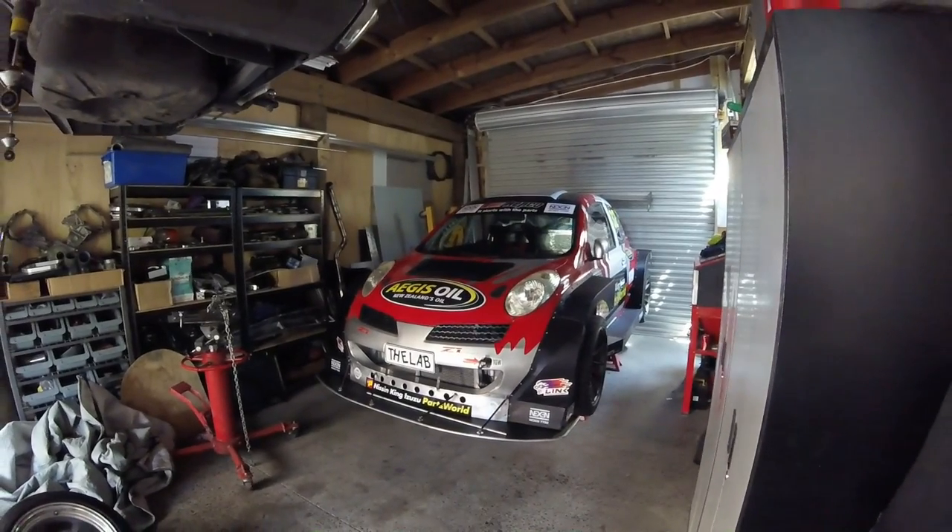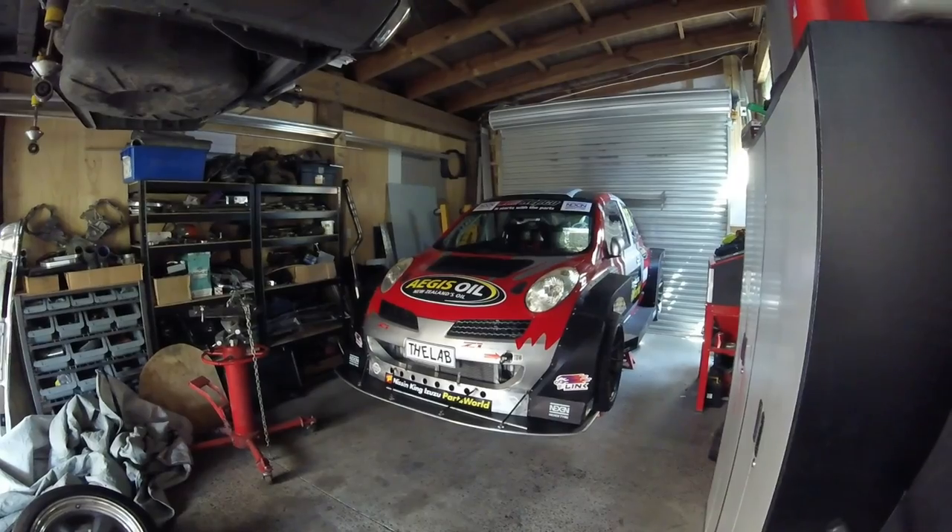She's ready to go. I'm thinking we need to do another drag race session. At the last session she was cutting out after gear changes - a surge in power, then cut, then come back again. What was happening is the boost pressure setting was too close to the manifold air pressure boost cut limit. There's a little bit of hysteresis, so if you're approaching it quickly the system will see it and shut off before you actually get there. We were only about 10 kPa away from the MAP limit and just bumping into that. That's why we only ran 11.8 or 11.2 or something in the 11s - the car's pretty good for a 10-second run, I'm pretty certain. It just needs to be driven properly without hitting the MAP limit the whole way.